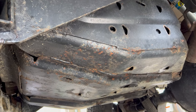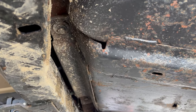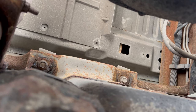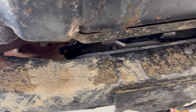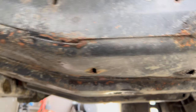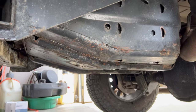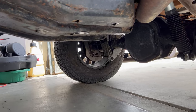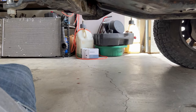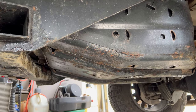Alright, here's the tank — big skid plate. There's two bolts there and there, and if you go to the front, there's two more right there. I tried to wash off the tank and missed quite a bit on the hitch, so put some safety glasses on. Four bolts, put a jack underneath it, we'll lower it down. I might have to jack the axle up a little bit because the tank's pretty tall, to get it to slide out between the hitch and the floor.